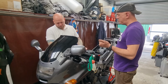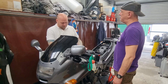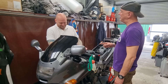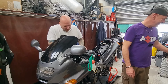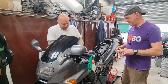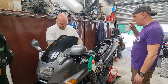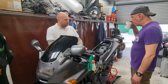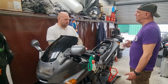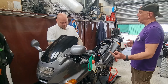But the fact it's intermittent is shouting electrical to me. A very wise man once said, most carburation issues are electrical. Or fuel. Or fuel. Because it could be... It's unlikely though that a jet is blocking and then clearing and blocking and then clearing. Otherwise all of them would be doing it, wouldn't they? Because the tank was all flushed out and cleaned and everything else, as were the carbs. There wasn't anything in there.